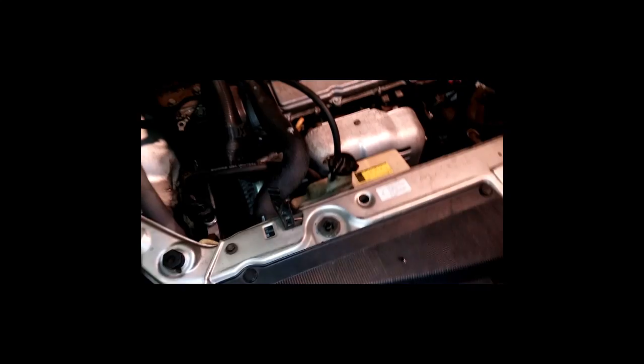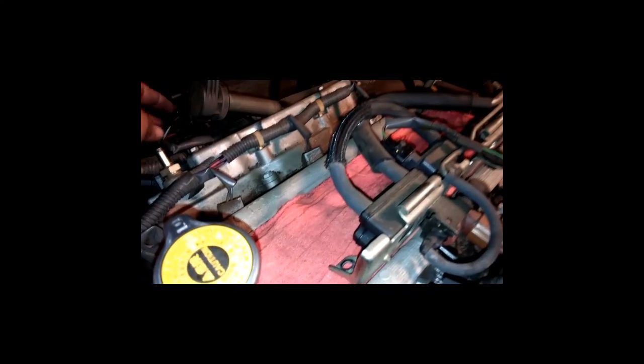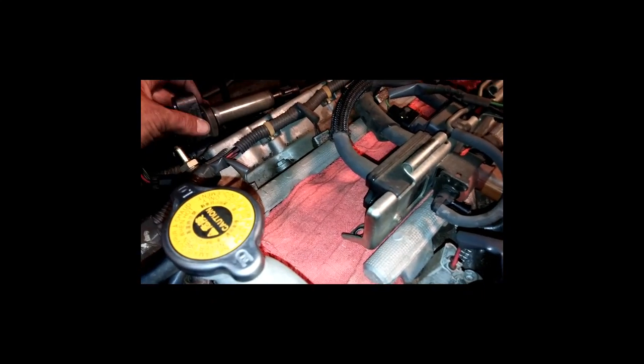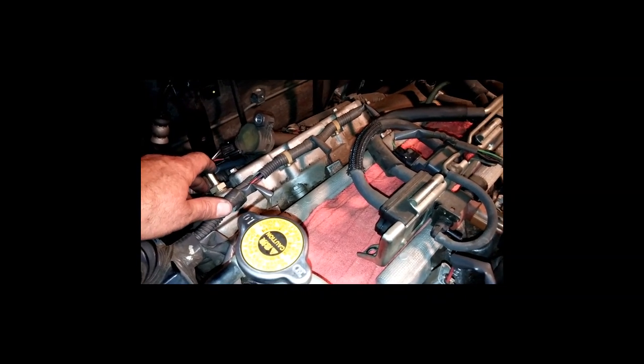Just be careful when you put it in there. All right. You got the back spark plugs here, and I found out the hard way that you don't actually have to unplug this from the coil pack. You do not have to unplug the coil pack, and the thing will actually come on out. This thing here kind of fought me. You see I chewed it up just a little tiny bit right there, trying to get that thing up out of there. But you want to be gentle. You do not want to force issues to get that stuff out of there, because you can break stuff.